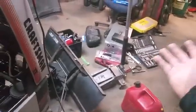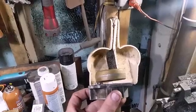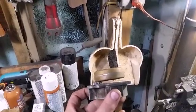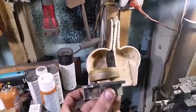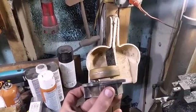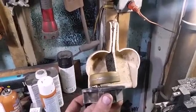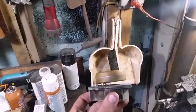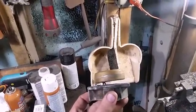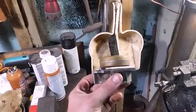I know it's a mess — it's not a garage if it's not a mess. I got my carburetor off. As you can see, it's sitting a little bit low. The two surfaces between the float and the carburetor are not parallel. I'm going to adjust that float to get more fuel into the float bowl.